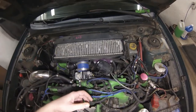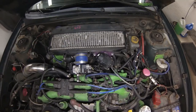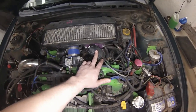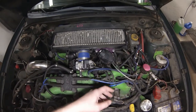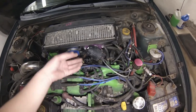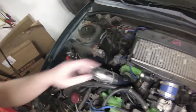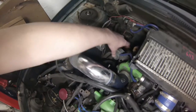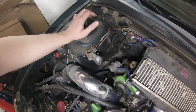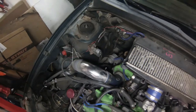with an eBay SSQV blow-off valve, or sequential. Gives it more of the chirp kind of sound. The original bypass valve that I just had going to atmosphere, because this is a MAP sensor car, no need to recirculate. It had a good huffing noise, but I could tell that it was leaking, so I replaced it with this one. And then this actuator, believe it or not, because it's looking so old and crusty now, that was a Godspeed 5 PSI actuator that I replaced the factory WRX actuator with, so that it will open the wastegate at 5 PSI.